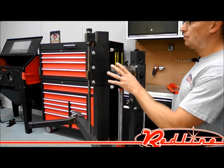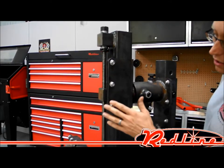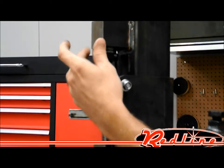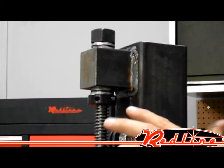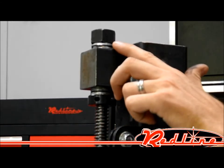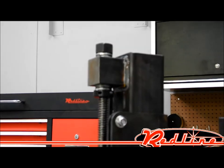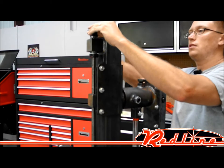And up on the top of the rotisserie, the balancing system is another thing that makes it very, very nice. You'll notice a huge steel block at the bottom, another one at the top, a nice big Acme threaded machine rod, and then, you can't see them again, but you have bearings right below and right above your balancing system block that allow this T-carriage to move up and down very, very easily. And I'm going to show you that right now.